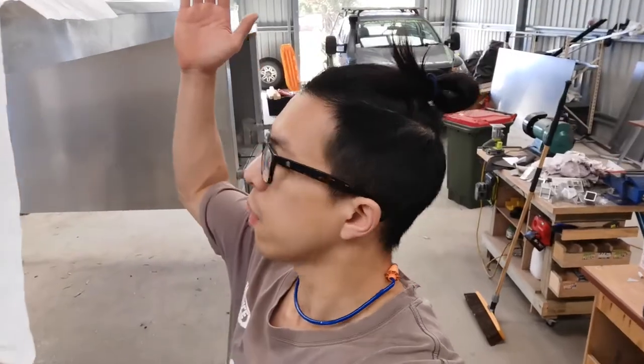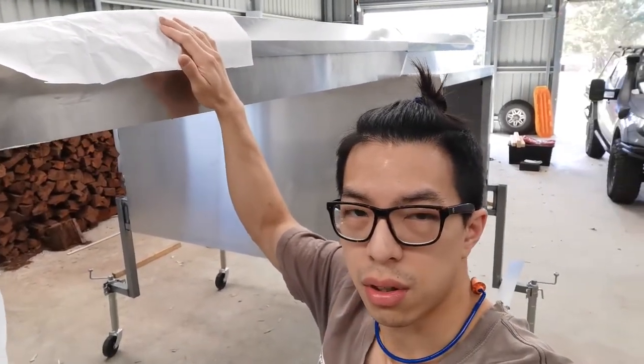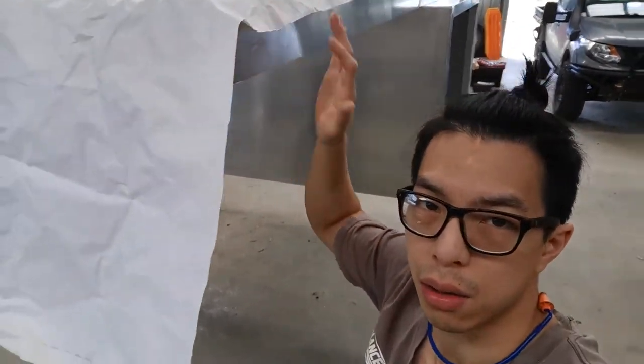Alright guys, before I start today's work, I'd like to share with you a technique that I've learned from a different channel. I'll put a link in the description so you can have a look at the channel's video as well. It is about making panels. You use a piece of paper, and very often you get really dirty hands and you use the dirt on the hands to mark the edge of the panel. It tells you exactly where the panel should be, especially when the panel involves a bend or some curves. It's a bit of a basic of metal shaping and metal forming, especially in the automotive industry.